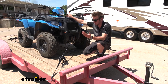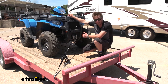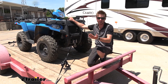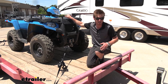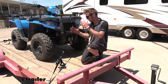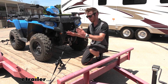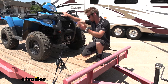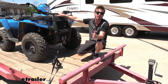Now with everything properly tied down, we have four straps — two in the front, two in the back. In the front I used the floating rings, which I really like just to protect my equipment, and that's great for all the other equipment you guys have. Between the four straps we have about 4,000 pounds of working load limit total, which is plenty. It's going to be great for side-by-sides, lawn mowers, and similar equipment. Just make sure you're hauling safely and have enough straps. I recommend getting straps that have the floating rings just because you have that option.